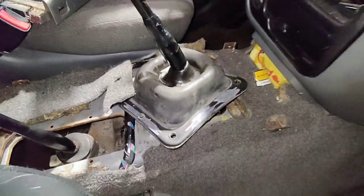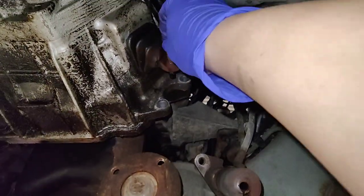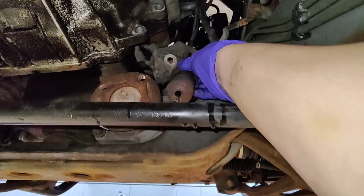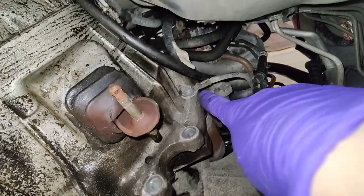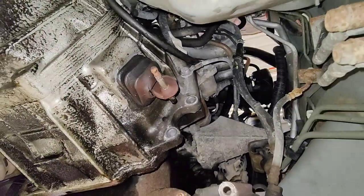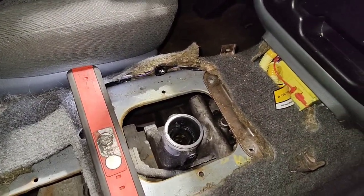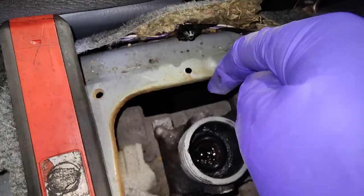I took the slave off — I left the pin in because I can't get that out. The boot was full of brake fluid for the clutch. Next I'm gonna remove the starter; the bolt is up top and there's one just right above it. I removed both shifters because I didn't think it was gonna clear the tunnel when I pull the transmission.